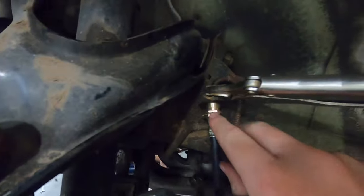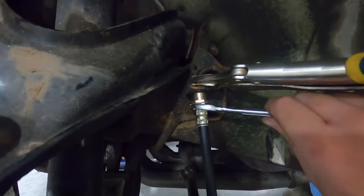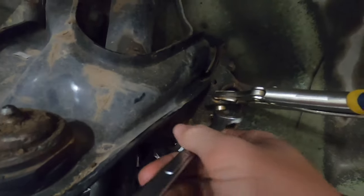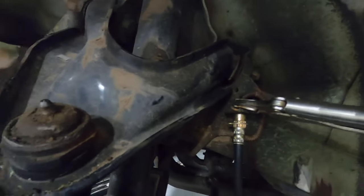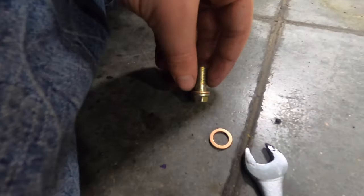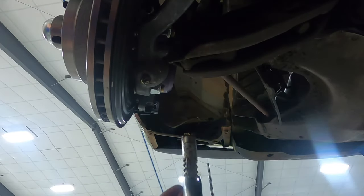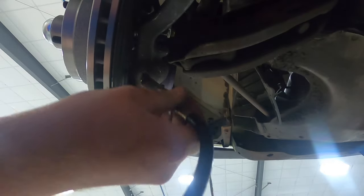The top brake line actually got stripped off when we were taking it off, so I just got the vice grip and I'm going to get it as tight as I can. Then I'm going to route the other one right to here. You want to make sure and put one washer on this — I got one washer right here — and then put the other one on the other side of the threads. I went ahead and got the grease zerk on the bottom ball joint in. So I'm going to go ahead and grease it up.